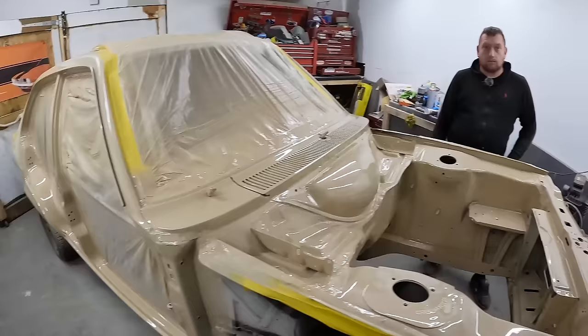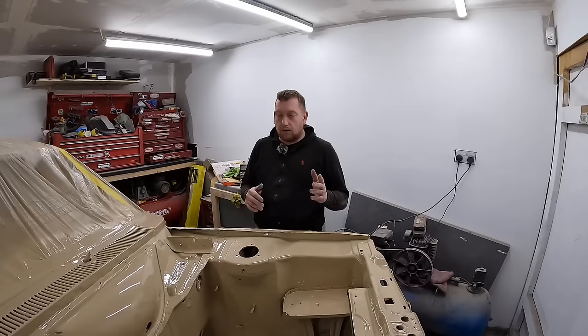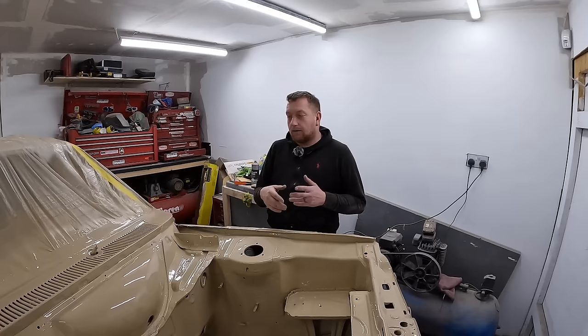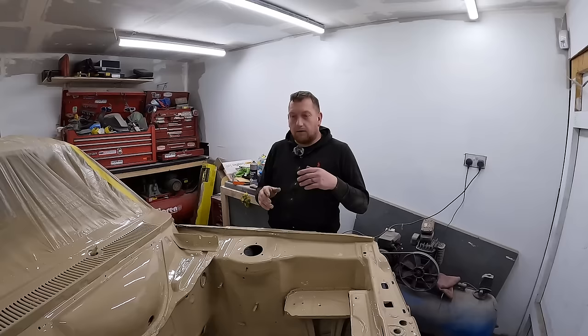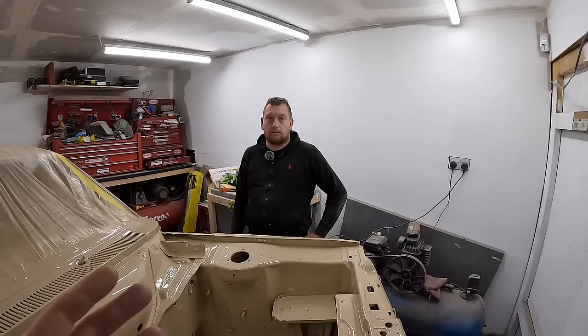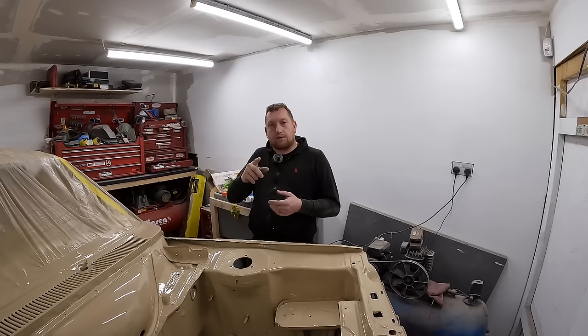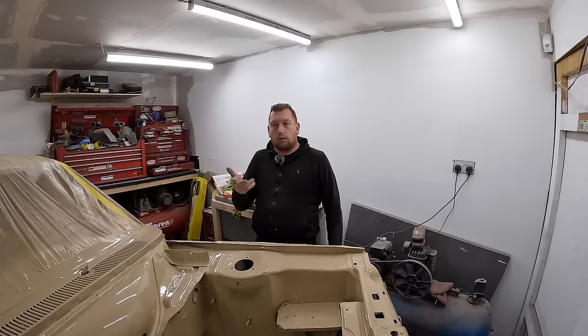I'm actually quite surprised how well I can do with a spray gun. With that mix ratio you can find a flow — you can see it in front of your eyes, so you know how far to push your paint. With an aerosol can you can't judge it the same way — it's nowhere near the same. Did you feel better with the spray gun than an aerosol can? Definitely. With a spray can the pressure is just set, whereas with a spray gun you've set it up and you can do half a trigger. You can come on and off — with an aerosol it's full on. With a spray gun you can ease off a little, so you've got more control.